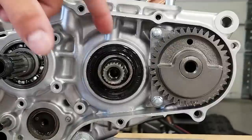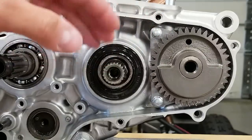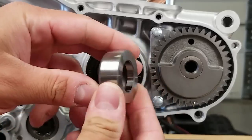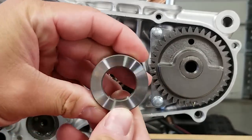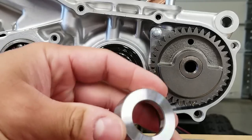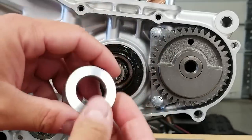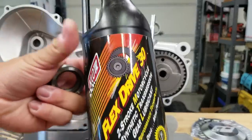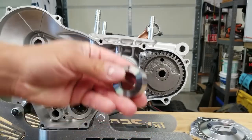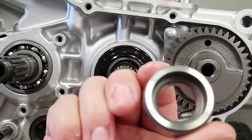Alright guys, we're going to get into the bottom end now. First thing we're going to do are our primary gears and our counterbalance gears. The counter balancer is already installed from a previous video. First thing we want to do is put our crankshaft collar in. I want to give a huge shout-out to Frank Anthony, one of my subscribers - he was watching my bottom end videos and told me he had a couple of these extra parts, machined and hardened by Gil Durbin. He sent me these parts just because, which was really nice. These parts are discontinued so they can be difficult to get. Before I put it in, I'm going to put a little bit of Flex Drive 30 on it - this is the transmission oil we're going to be running, so you really don't want to put this stuff together dry.